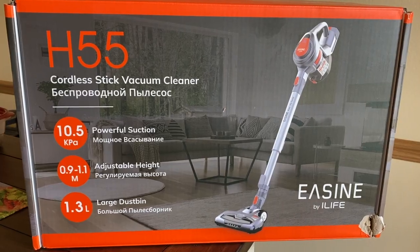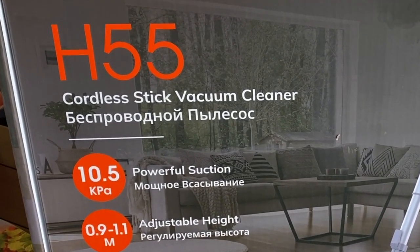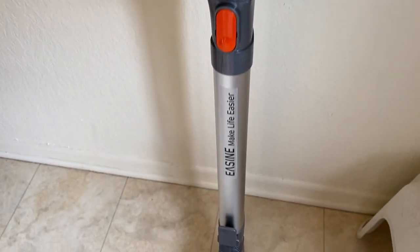Let's take a small diversion into suction power, because this is important. The designated suction power defines the type of vacuum you're getting and what your expectations should be, but there are also other factors like wattage, airflow, and airspeed. Since iLife prints the suction pressure on the box, I'll focus on that. The rated suction on the H55 is just over 10 kilopascals. Typical power for a portable vacuum is about 20, so this is definitely on the weaker side. Anything close to 10 is meant mainly for light dust and dirt. Getting up to 16 or 18, you're able to lift crumbs and small particles. Climb into the 20s and you get better suction overall — the type that can lift coins, batteries, and more. So this vacuum is technically performing as you should expect for the stated suction pressure.